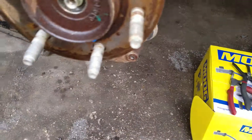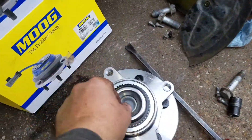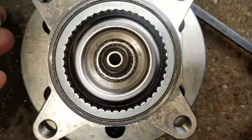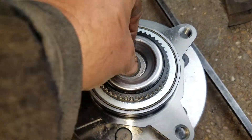What I'm working on here today is a 2012 Ford F-150 4x4, and this front hub on here is making a little noise. I'm figuring that either this needle bearing in there, or the roller bearing that comes out the other side is making a little noise, and you can just barely hear it.